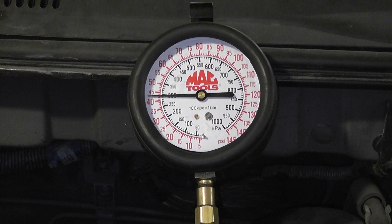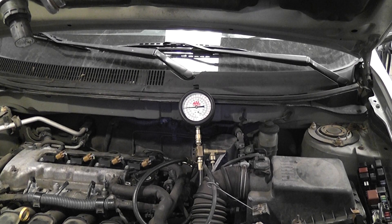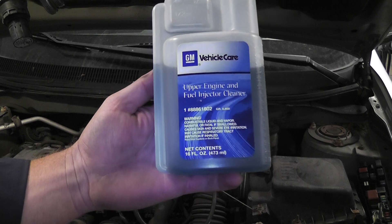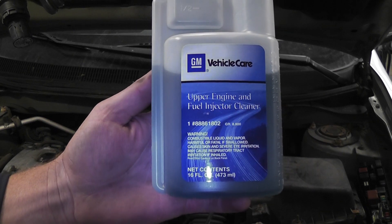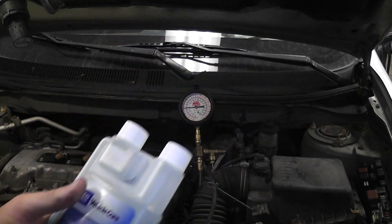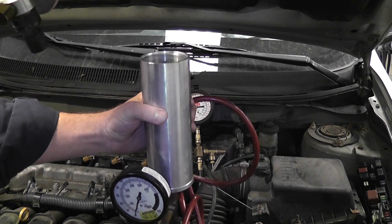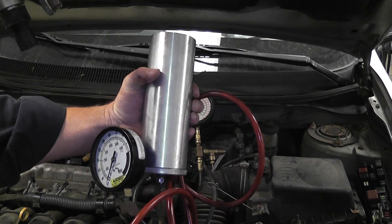Before we disable this fuel pump, I'm going to use the fuel that's in the tank for my cleaning kit, so we need to get some fuel first before we disable the pump. This isn't the only way to do it — if you have some gasoline sitting around, mix it up, that's fine. But I typically don't. The cleaner we're using is this upper engine cleaner right here. It's made for GM vehicles and we're mixing it about 15% cleaner to 85% gasoline, and I'm using a container that's going to be air-pressurized to supply pressure for our rail.